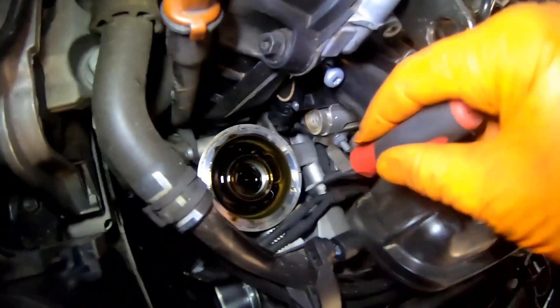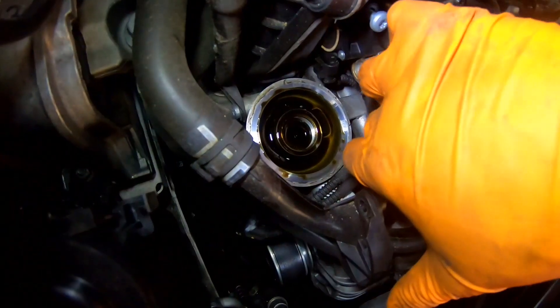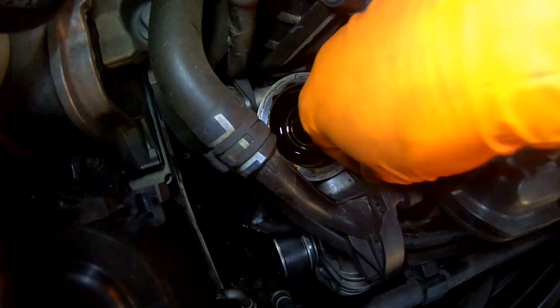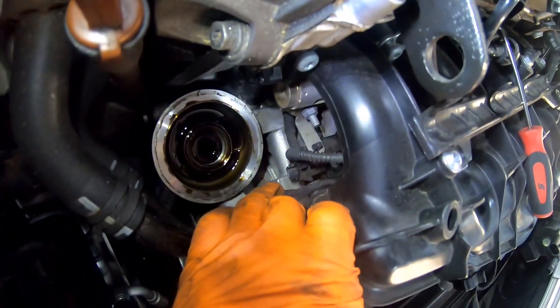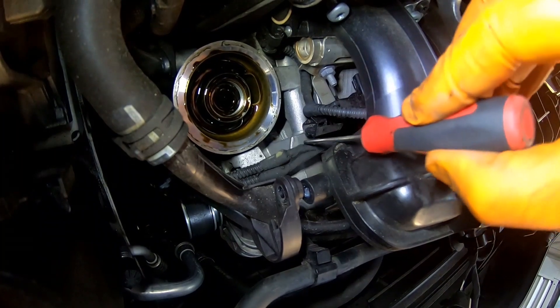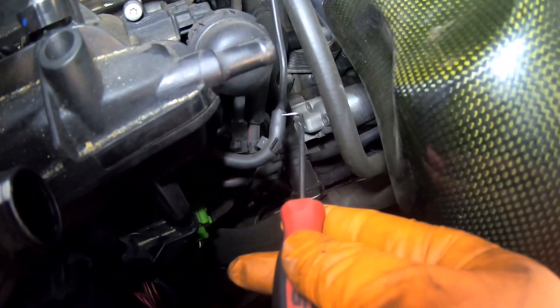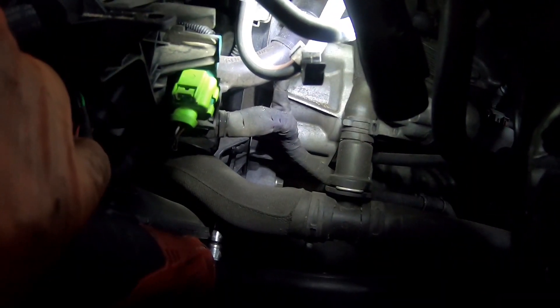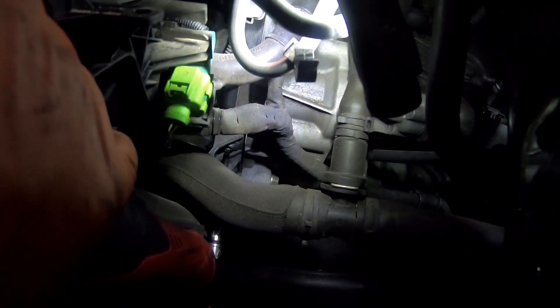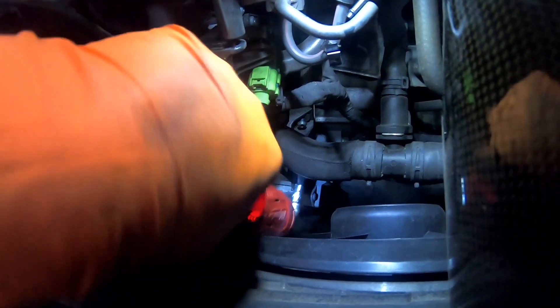Now with the oil filter out we can get down into the wiring harness. We undo this clip allowing us to disconnect our oil pressure switches, and separate them from the engine harness so the manifold can come up without dragging it - there is a wiring harness that comes up with the inlet manifold due to the injectors being up in there. We'll disconnect this vacuum hose going down to the solenoid underneath the manifold which controls the inlet manifold flaps. There's another T30 down here bolting our boost pipe to the block, and once that's undone we'll be able to push the boost pipe off the throttle body.